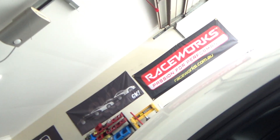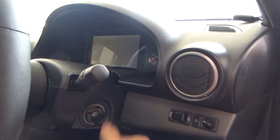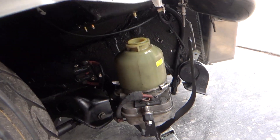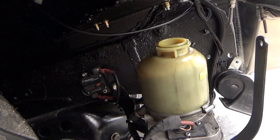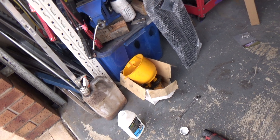Time for one of those two-birds-one-stone sort of situations — we're going to flip the car on, bleed the power steering, and bleed the radiator. Let's do this. See how this cold starts today. Not too bad — little bit of accelerator. Here we are. Turned the power steer pump on and I can start to see the level will go down. What I'm going to do is top it up with LDS — can probably barely hear me — and then just got the radiator popping out. I'll touch up the throttle on there now as well and get that to bleed up while I do the power steering.